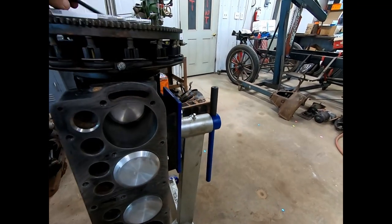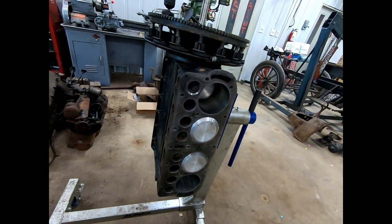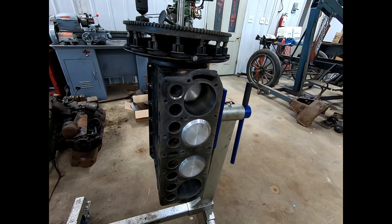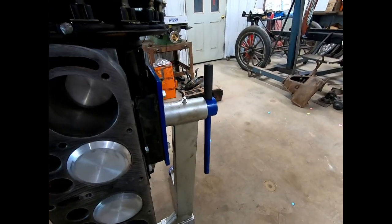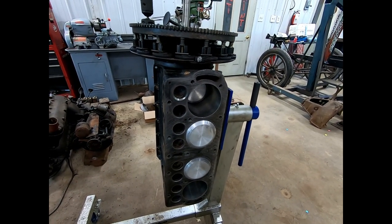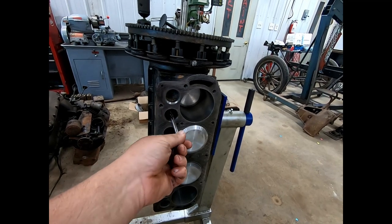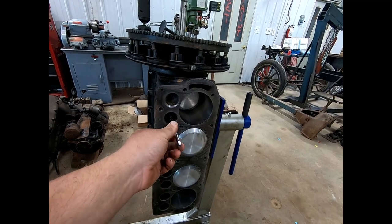We'll pull this out of here. So I didn't notice when I was cleaning up, because it's kind of hard to do one-handed, so everything was kind of screwy. So this is a 1/32 reamer. No, sorry, 1/64, the smaller one, 1/64. Because when I checked valves, I'd only checked one, should have checked them all. So you see the reamer starts in and stops, just like it should. So there we go.